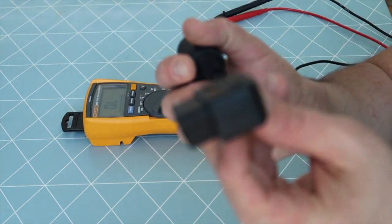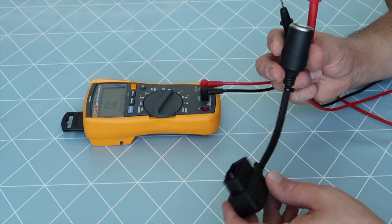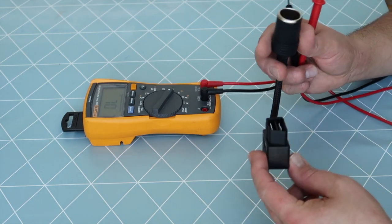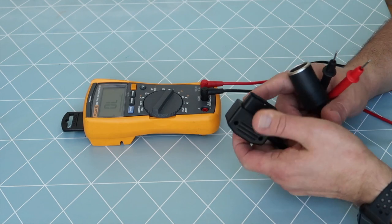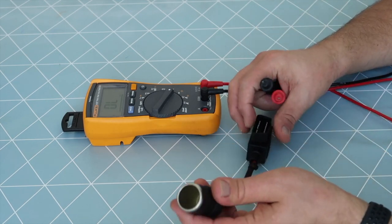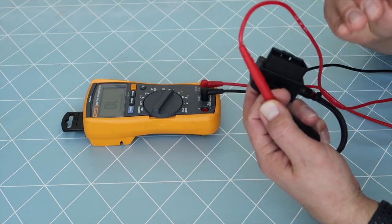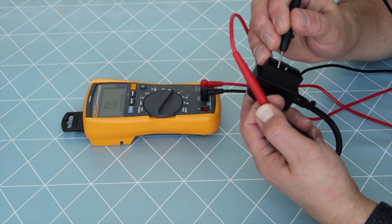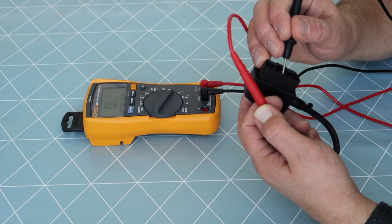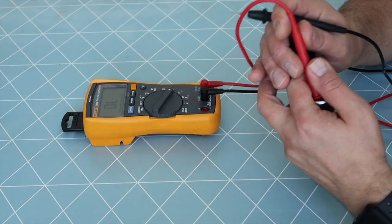Two thousand years later... Okay, this is finished. Before you plug it into your car you want to make sure everything is connected. I'm going to check that pin number 4 on the OBD2 plug is the ground — I hold one pin against the ground on the 12 volt plug and check it with number 4 on the OBD2 plug. And I'll check all the other contacts as well. The plus is pin 16.